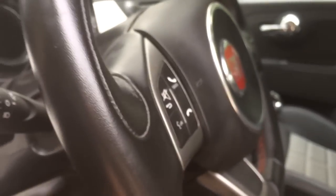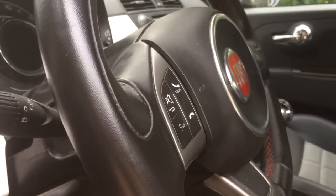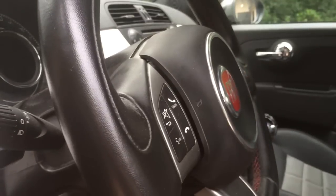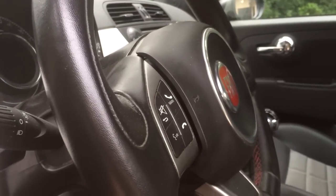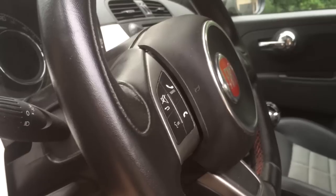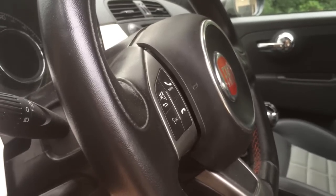So it's back in just a little ways. I'm pushing it in right now, and I have to set down the camera because I have to use my other hand and simply pull this side of the airbag out slightly to make sure that it is unlatched. The only thing I've done now is reached over and unlatched this side of the airbag from the tension clip. Now I'm going to turn the steering wheel around and do the same thing on the other side.